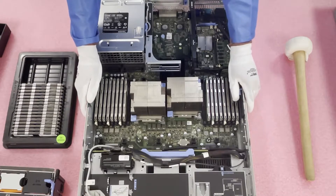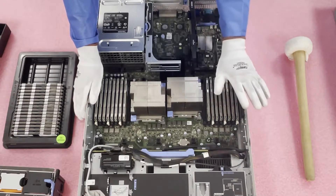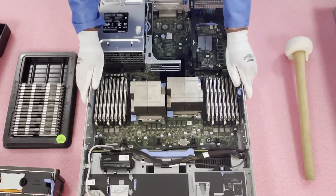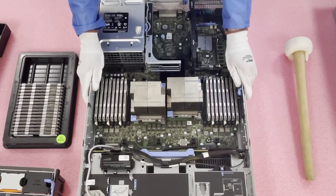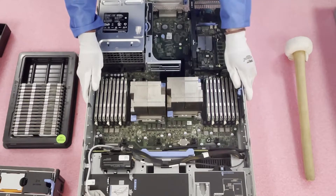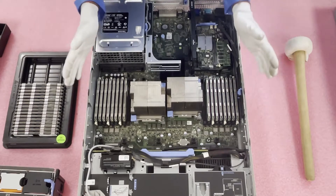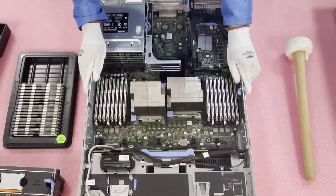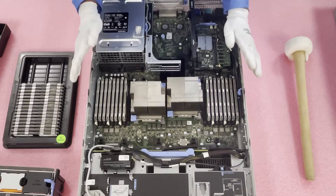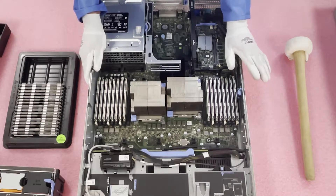One very important thing to discuss is the type of RAM that the R710 accepts. This is an 11th gen server and it only accepts ECC registered memory. Technically you could put ECC unbuffered in here, but it's a higher price point and you can only max it out at a very low amount, so it's really not a viable option. A lot of people ask if they can put LRDIMMs — load-reduced memory — in here, but unfortunately that's not until the 12th gen, which is the R720. For the R710, it is strictly ECC registered.